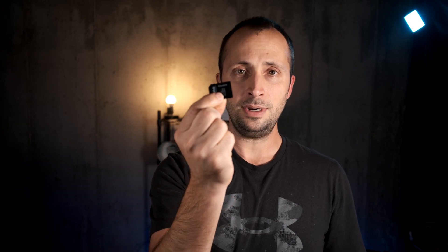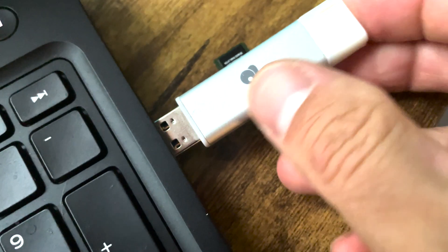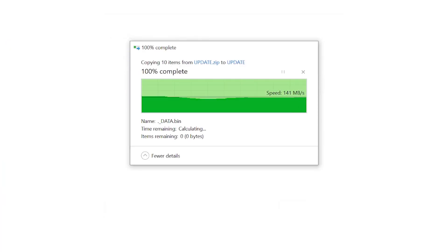You'll also need an SD card adapter if you have an SD card slot on your computer. If you have a micro SD card slot, you can pop the card in directly. If not, you may need a USB micro SD card reader. Insert the card into your computer, then go to the folder you extracted. When you open it, you'll see an update.zip — extract that folder too. Note: unlike normal manual GoPro updates, you don't just copy the top-level update folder. There are a couple of levels down where the actual update folder you need is located.